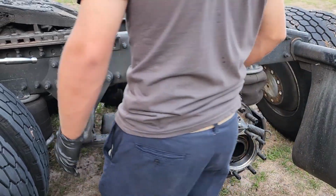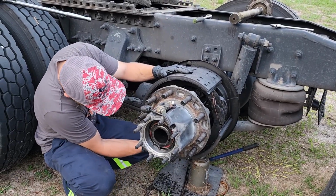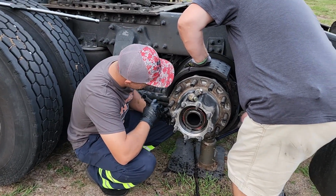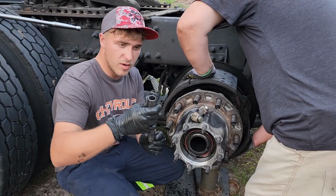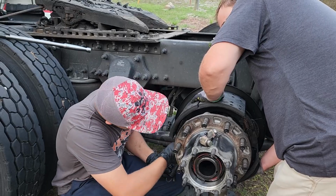So if you followed this video exactly, you'll be kicking yourself in the butt just as much as I am right now. You see, I went ahead and installed the hub before putting this large spring on for the shoes, and I should not have done that. So if you're watching this video first, here's a heads up. Go ahead and reinstall your shoes just like I took them apart originally, but do it before you put the hub back on so that it's not in your way.